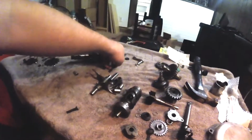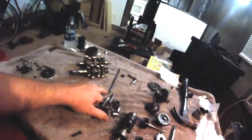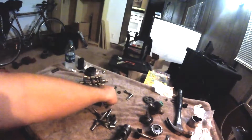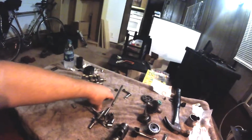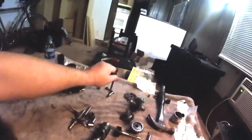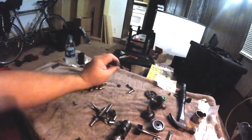The clutch rod that goes across. A lot of these clutches, guys, got to watch. There's a ball bearing. It either rests between here and here, or it rests inside of a closed shaft, or more commonly, this pushes on that. Yamaha likes to do this a lot, and then they put a ball on the other end before the thrust bearing on the clutch pressure plate.